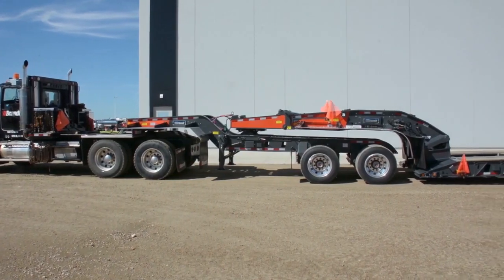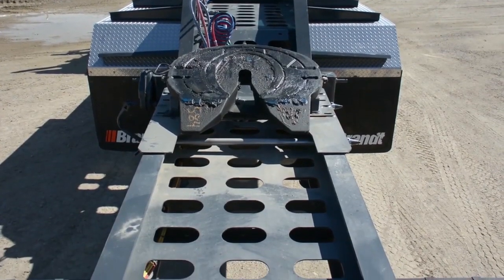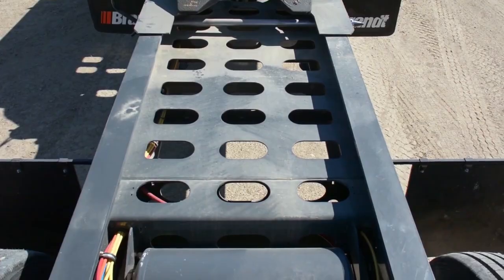The next being a full plate form cross member that runs from the top of the neck of the Jeep back beyond the upper fifth plate, meaning that it's going to stay far more rigid than our competitors' bolted designs and be far less prone to cracking than many other Jeeps on the road.